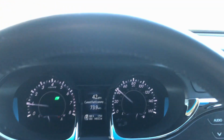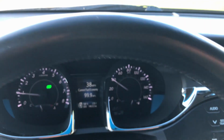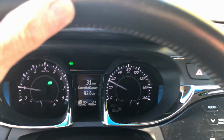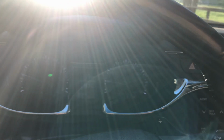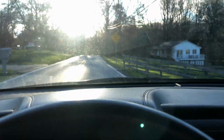Brakes, so I'll add this. So at 146,000 miles: transmission filter, dump the pan, and put in 2 3/4 quarts of ATF.